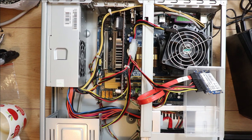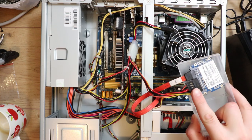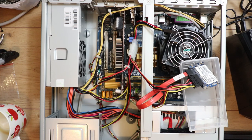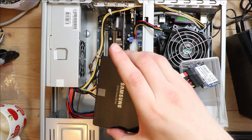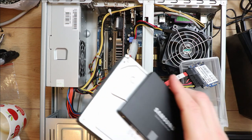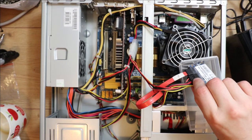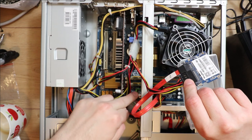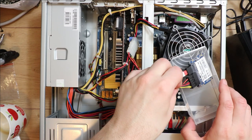Finally, seeing as I've spent so much time on this, I'm going to do a boot time comparison for each drive — the 32GB SSD on both the IDE adapter and onboard SATA, plus the Toshiba mechanical drive and Samsung Evo each on onboard SATA at their best, just to see if the difference between onboard and IDE is notable in real-world boot times.